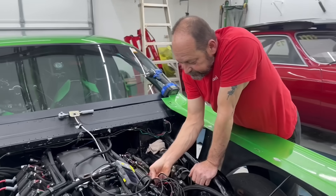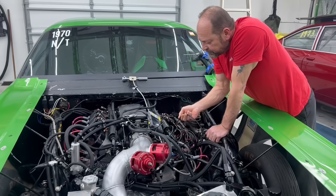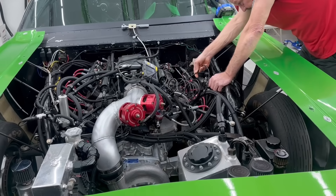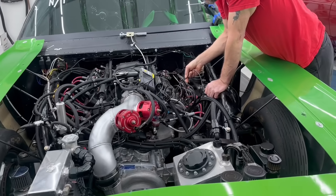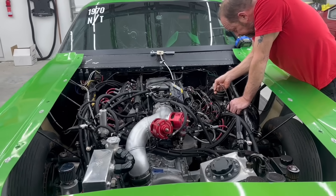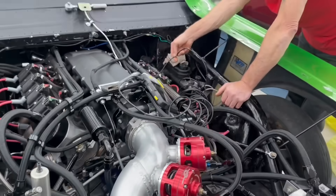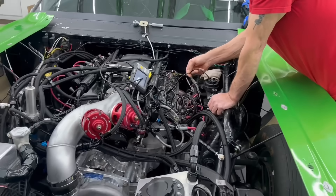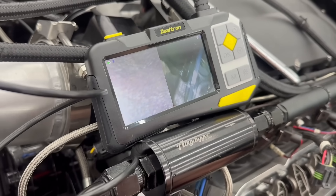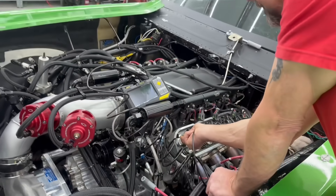This is the second or third oil change — it's sparkly clean, Brad Penn oil. Trying to figure out what it could be. He reused the oil pan, heads, and valley covers. There's a chance that old pan trap doors, screens, or the timing cover area could still have metal from the previous blow-up. He took the valve cover off, pulled a rocker arm out, and checked the lifter valley — generally when you kill a bearing you see material in there.